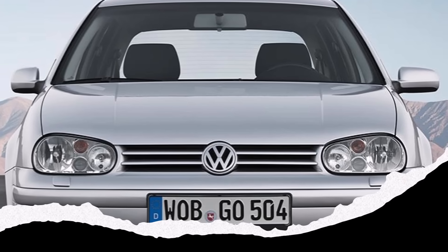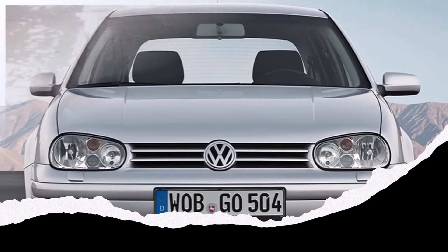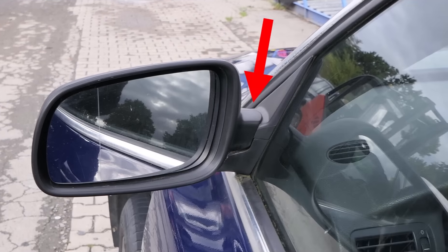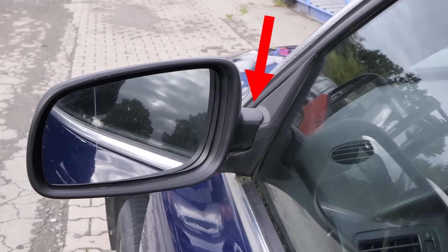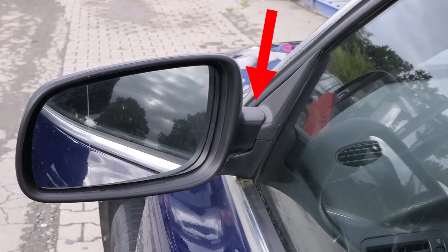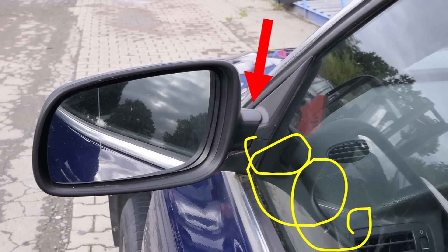But now there was still the mirror mounting in the way, which still connected to the side window. And because the mirror was further outboard now, there needed to be a mechanism to fold the mirrors, and such a hinge is not small. It's hard to optimize aerodynamics here. So there was still a separation bubble on the side window which created noise.